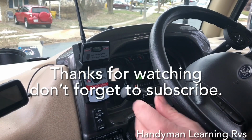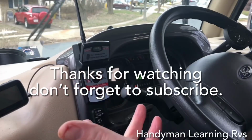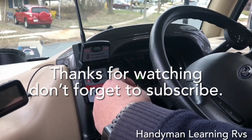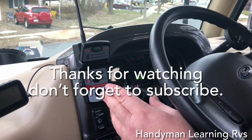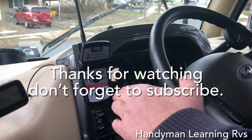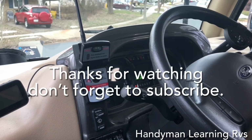If you want to turn the wipers on and off with the multifunction switch, you want to turn it at a normal speed and it will turn on. Turn it off at a normal speed, it will turn off. What it's doing is making a momentary contact between these two delay modes. You press the windshield washer wiper, you hold it in, your windshield washers come on. You let go, it will squirt out a little bit more, then give it a couple more swipes to make sure it got all the fluid off, and turns itself off.